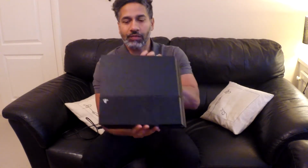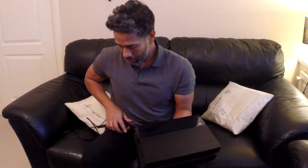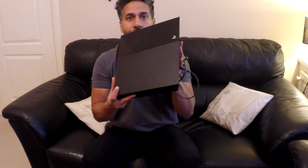This is a friend's PS4, this way around, okay, and it won't start up. We've checked with a different cable, we've checked the fuse, nothing. No clicking sound, no lights, no LEDs, no fans. I have a feeling there's a power supply unit in there, PSU for short, and I have a feeling that's gone kaput and we need to take it out and check, because there's some PSUs which are 4-pin, 5-pin, and just got to check and make sure before we order the right one.